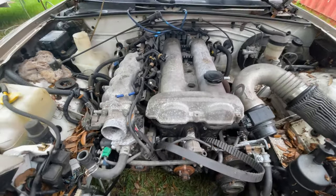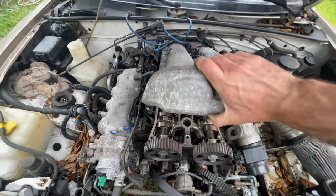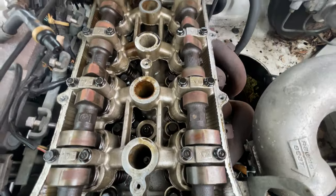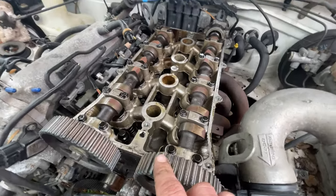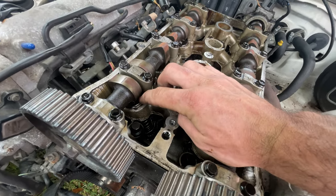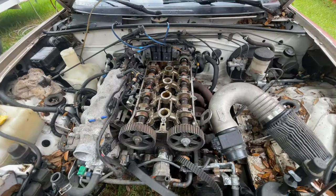The timing belt is just chilling there, but luckily we've got all the spark plug wires and everything. We do have the hardware for the valve cover but the valve cover is just loose so we can just pull that off. The cams do have some surface rust on them so we're going to hit those with some scotch brite. What we decided from the research we've done is that these hydraulic lifters actually go bad — I can move that one but the next one moves a little bit, and that one I really can't move at all. The lifters seize up over time and you can clean them and get them to start moving again and quit ticking.